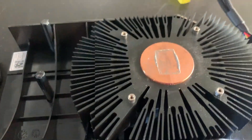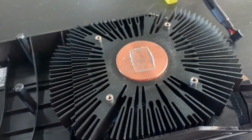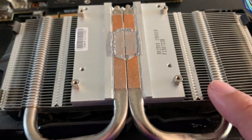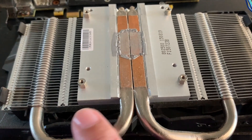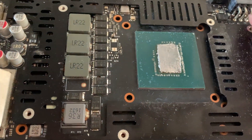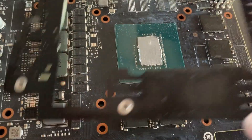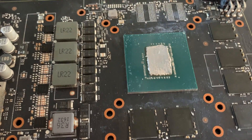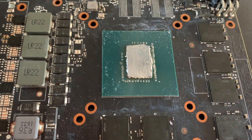Here's the old heat sink, which is larger than the one that originally came with it — the other one stopped here, and part of it was missing. Here's the 950 heat sink: very large blow-through design with copper pipes — this would definitely go nicely. But it doesn't fit in the original holes, so I have to take off the memory plate that I just added to this card, and then it will fit. I already test-fitted it using the outside holes, so we'll try that.